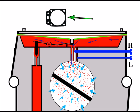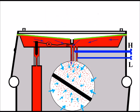But just to illustrate, this is what these gaskets normally look like. And they are designed so that they span around the outside of the diaphragm, allowing the diaphragm to come down in the middle. So they've got a hole in the middle there to allow that. My point is as well that the diaphragm always sits on top of the gasket. So there we go, everything present, all working well. We've got the gasket and the diaphragm there. And at the moment, the piston is on the upstroke drawing in fuel.